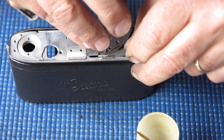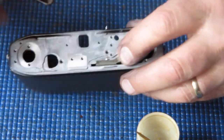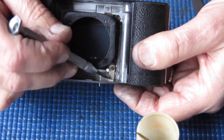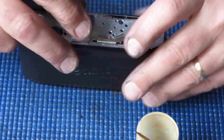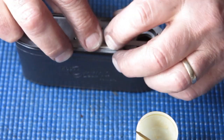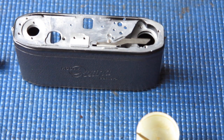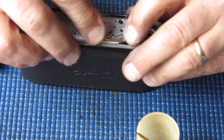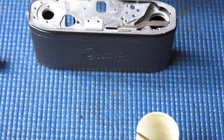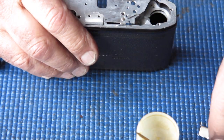I'm going to use a four-thousandths-of-an-inch feeler gauge here to set the distance that the rack runs against the body. The hole is oversized so I can slide this bracket backwards or forwards. If it's too far forward there's too much slop — the rack, which is quite narrow, won't be contacting the full width of the gear below it, so the load would be taken over a narrow strip of the teeth and stuff wears out quickly. A four-thousandths gap means it will move smoothly without binding up, but still keeps the teeth in good contact.